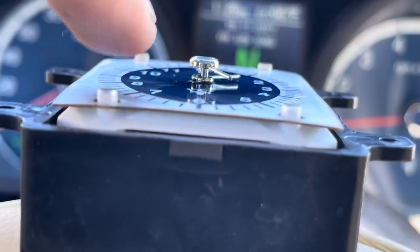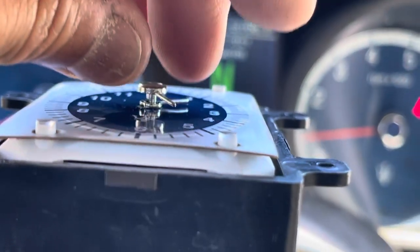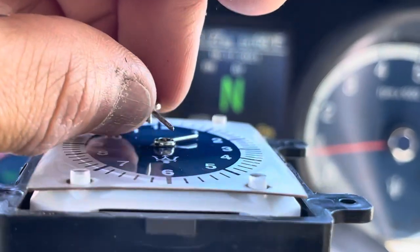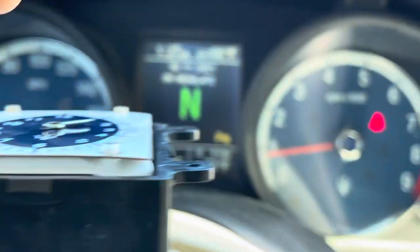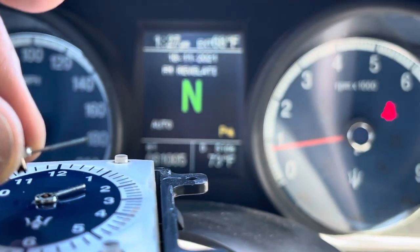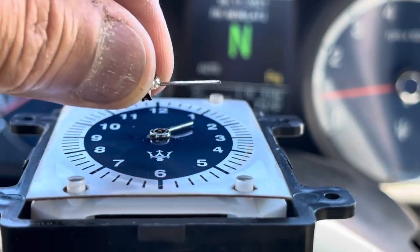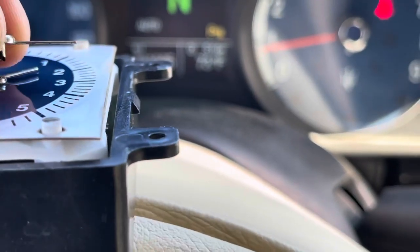So, I got a little screwdriver, and I put it in between the hour hand and the other hour hand below it, and I just twisted, and it should come straight up. There it is. As you can see, it's a round cylinder at the bottom and it fits on there. So, what you're going to do is, if you know how many minutes the clock is off — right now it's 1:27 — I knew every time I reset this clock, which is by taking this thing out and putting it back in, it would be 20 minutes off. So then I just put this wherever 20 minutes ahead is, and then I set it right back on like this.